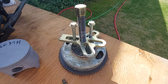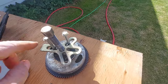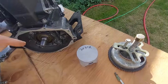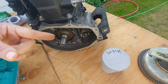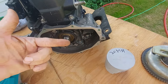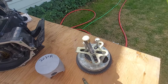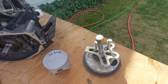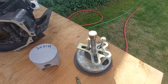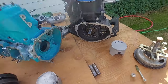Get it on there tight and start threading the center bolt in until it's pushing, then give it a few taps on the end with a hammer. Sometimes you use a crowbar or a solid piece of hardwood to keep it from turning as you're turning this with a ratchet. You don't have to go crazy — usually just tap it. Sometimes you do have to use a little heat, but normally I haven't had to use heat to get them off.